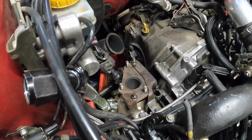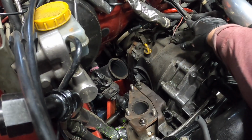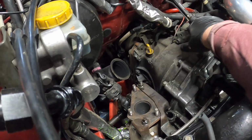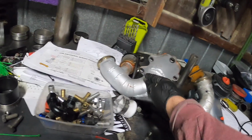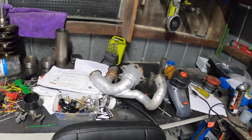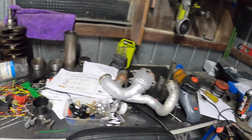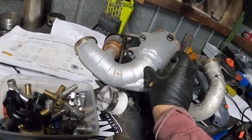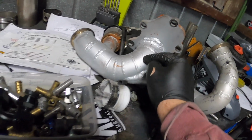One issue that I've seen is the pitch mount. It's rubbing on the pitch mount. It's actually freaking melted it. So now that we don't have or won't need this going in, we can probably tighten all this up. Not yet though. So we'll cut that off, make a bell mouth probably to this notch here, and then we'll see if that setup works.